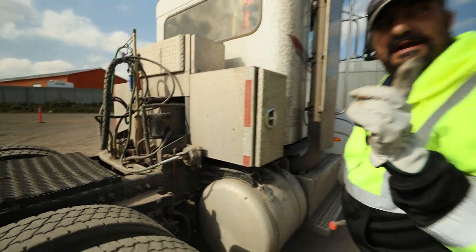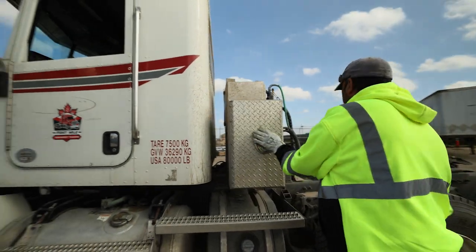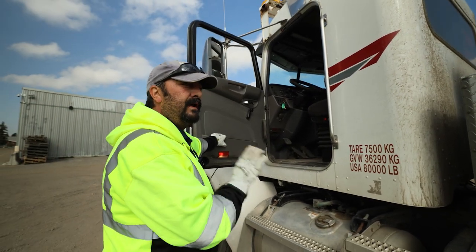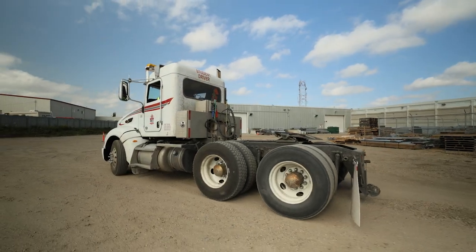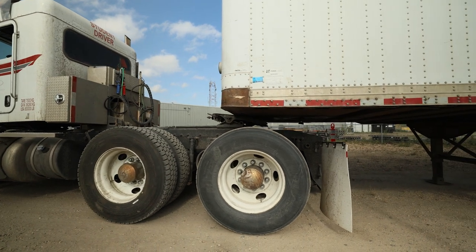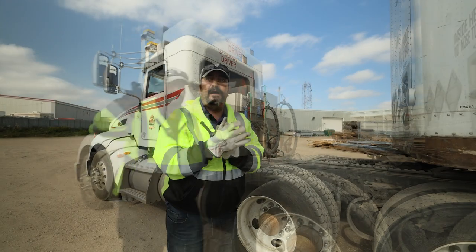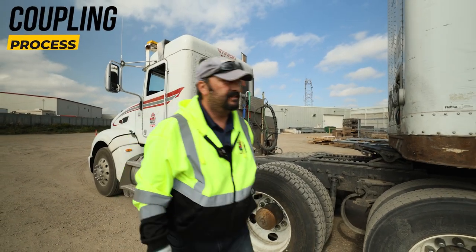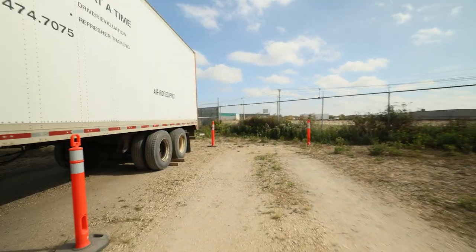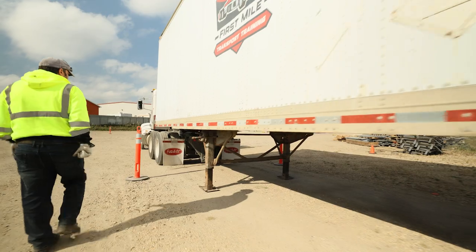At this point I'm going to get back in the tractor — put my hammer away, back up to the trailer with four-way flashers and horn, and line up for the coupling process. Three-point contact. Reverse nice and slow, four-ways and horn, and line up to the unit. Coupling process: we're all lined up back to front. Verifying again my wheels are chalked or blocked — securely blocked. Landing gear is secure, so the trailer's secure.